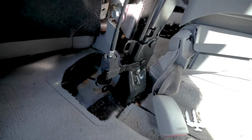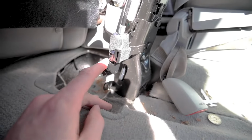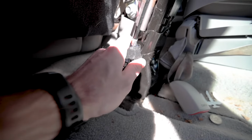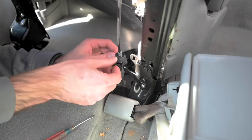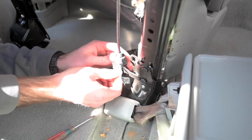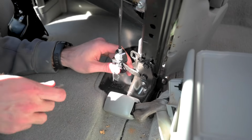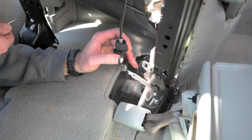And so we have them up right now. This piece right here is where the cables connect. You've got to take this tape off if it has tape on it and unlatch this to be able to get the cables disconnected from one another. All right, taking the tape off of this so I can get to what's underneath and see how this thing is latched on right here. It's gonna take some prying, but if you get underneath this, it just slides right off just like that.